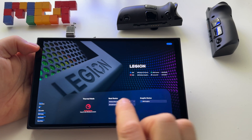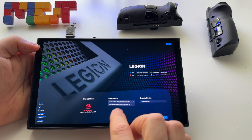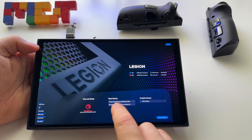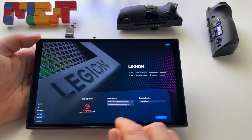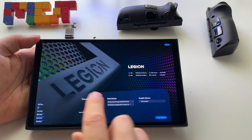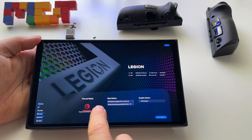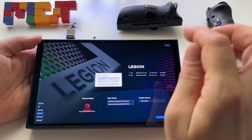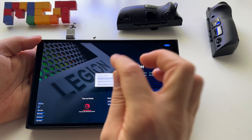Once in BIOS, check if your SSD is recognized. Here we have Kingston — this is it — four terabytes. And we have the USB device. Change the boot order: press up to put the USB first, then press Exit, save and exit. After that your device will boot first from this USB drive. Otherwise, as I said, it will display a recovery screen with troubleshooting options. That's why I advise you to set the boot order in BIOS first.